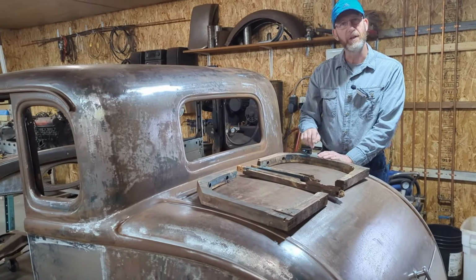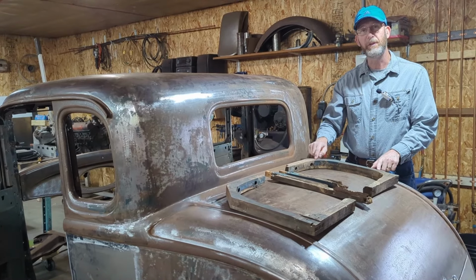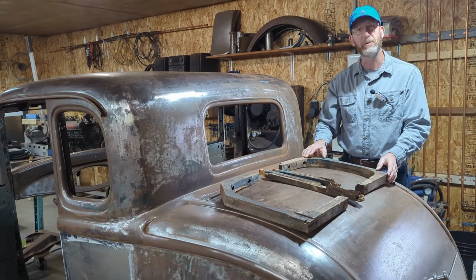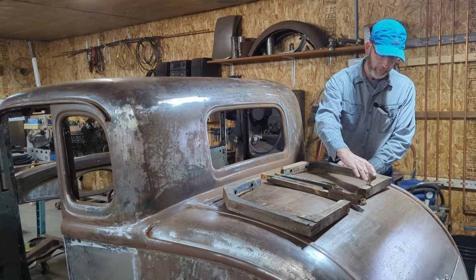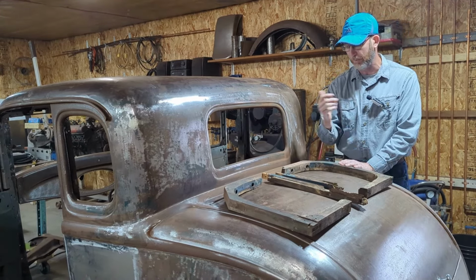I did notice that on these rear window pieces versus the Moncton Coupe, these are put together with wooden dowels, whereas the Moncton Coupe, which is the same year, had three pieces that were actually screwed together. So in this case, I'll duplicate what this car has, make two new pieces for the bottom and two new wooden dowels, and get those fixed up and ready to go in.